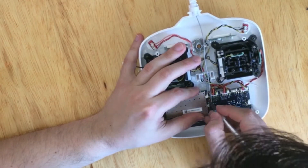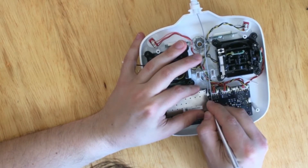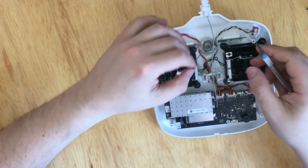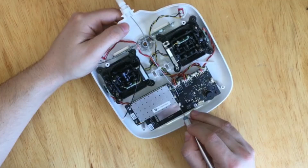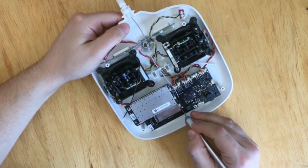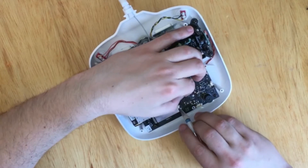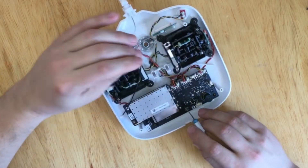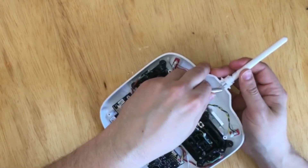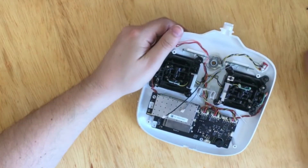Make sure you remember: the top connection is for the right Wi-Fi, the middle connection is for the left Wi-Fi, and the bottom is the main antenna. When you install the DBS antenna, make sure you remember that and put them in correctly. After you've taken all the cables out, just push on those two clasps from the antenna and they'll come out.